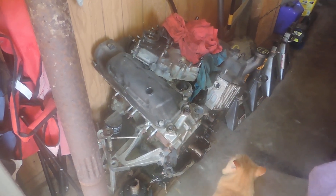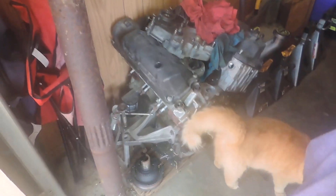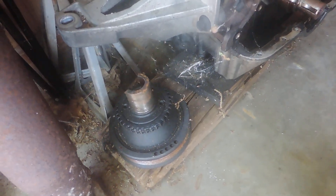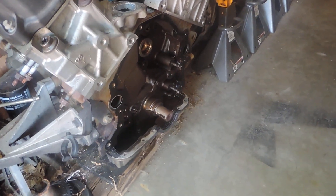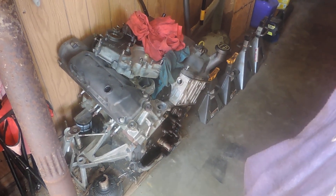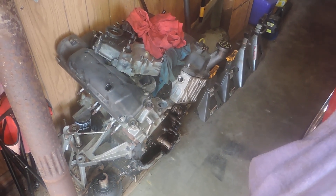As you can see here, the 4.0 — Chester has just pointed out — has suffered a fatality. The harmonic balancer is actually broken, which caused the timing chain sprocket to break and jump time, bending all the valves and breaking a couple, which then destroyed the heads and the pistons in those cylinders.